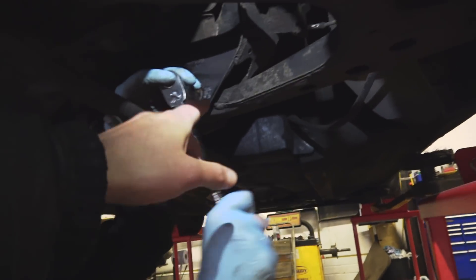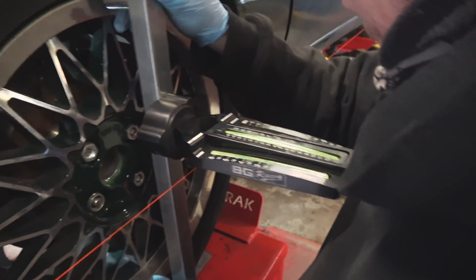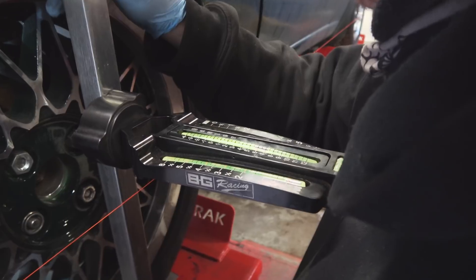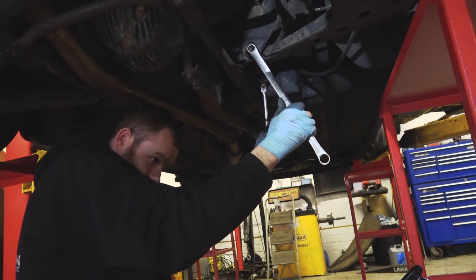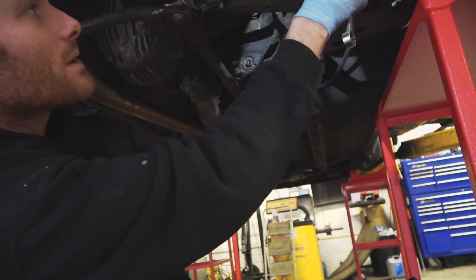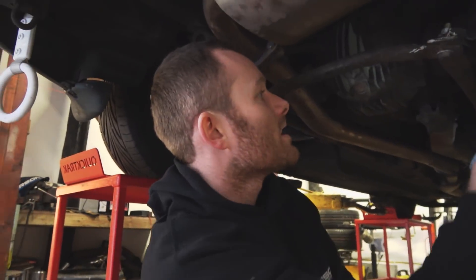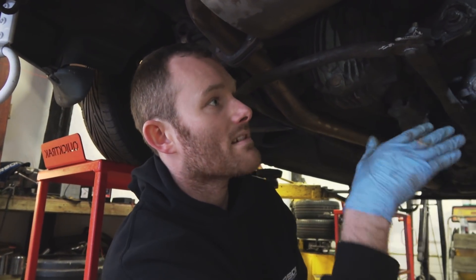Scousey is adjusting the bolt here which moves the arm in and out. Once these are all tight I'll go around and do the same thing as what I've done with the coilovers — paint a pen mark on them just to see where they've been left, so if they were to hit a big pothole or something like that you can see where it's been knocked out and then you can just realign it. We've also got some exciting news — Scousey's chassis leg for his GT86 has just turned up.